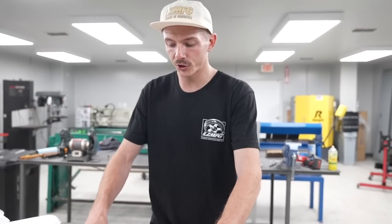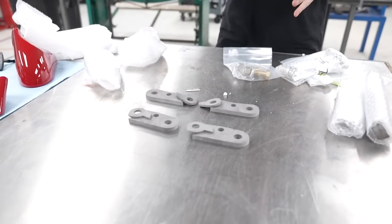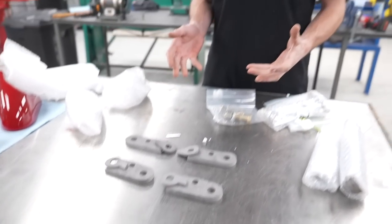But I had him send me three different iterations because I'm not sure where the best tie rod pickup point is going to be. So again, this is the development phase. I'm taking something that he put some time into designing, figuring out what feels the best, and then this will probably be engineered to look and be constructed in a different manner. But unlike my really terrible knuckle, this shouldn't instantly bend a tie rod and should be good enough to test and get a bit more angle on a stock super knuckle.